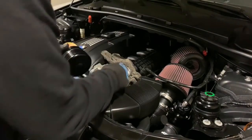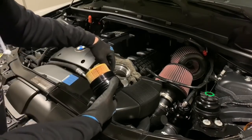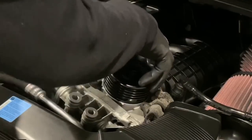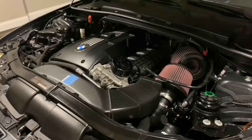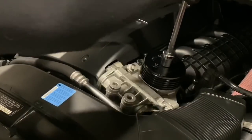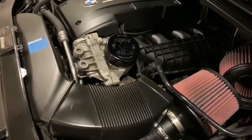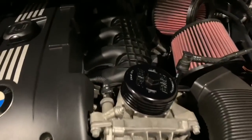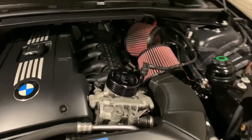With all new gaskets on, you are ready to go. What I also do is clean the mating surface off here to get any residual oil so it has a nice clean seal — metal to metal kind of contact. Hand tighten it, then take your 19 millimeter, and right when it stops you're good. Here's what it looks like within the engine bay — looks good under the hood. Now all I have to do is use my 19 millimeter hex and I can go do it. Makes it simple and everything looks great.